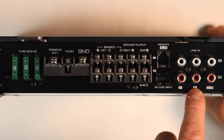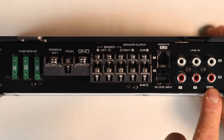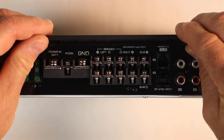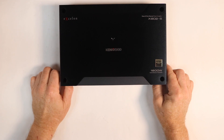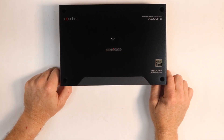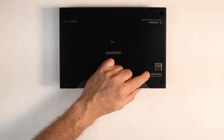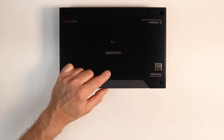The high-level input plugs in below the bass knob connection, and your six RCAs are located here, going A, B, sub. It also has a little removable panel designed to finish off the amplifier and cover up the screw-downs. When viewing the amplifier from the top, it gives it a nice clean look. This amplifier is also high-res compatible, meaning it has a frequency response of 20 to 50,000 Hz on the high-frequency side, and 20 to 200 Hz on the subwoofer portion.